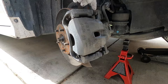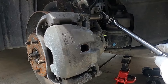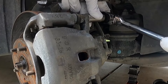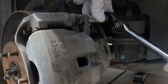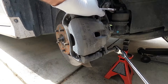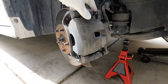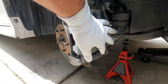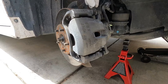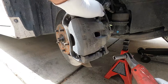Now we can loosen and remove these two slide pin bolts. They go into this little slide pin which has a little hex shape. I'm using a 14 millimeter socket on the slide pin bolt. That one broke loose no problem. If the pin spins, you can put an open end 17 millimeter wrench on there to hold it steady. Both broke loose just fine. These slide pins are a little stiff, which is why they're not spinning, but sometimes they will spin and you'll need a 17 millimeter open end wrench — it needs to be a thin profile. I just happen to have that thin profile wrench which works really well on these.